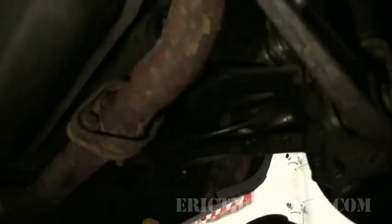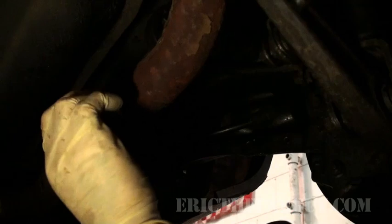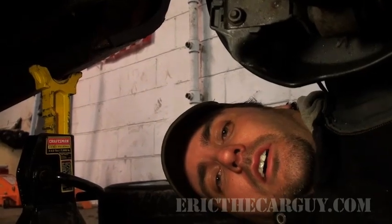One more thing for you. Okay, before I start heating, I'm gonna see what size fastener this is so that I'm ready to go to take this off as soon as I'm done heating it. You don't wanna let it sit in the heat for a while. So, like, get the tool ready. It may be rusted away so bad that it's not a size anymore. And if you can't get it in metric, see if you can find a standard socket that'll work. And if you have to, hammer it on. But have that ready to go so that when you're done heating, all you've got to do is just pretty much knock the fastener out and away you go.